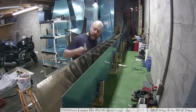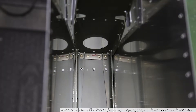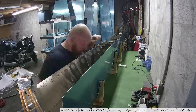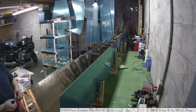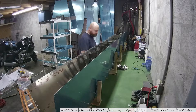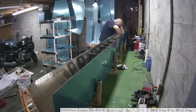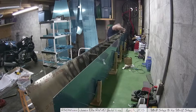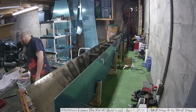It could not be done any other way. And again, this is another one of those examples of you really have to follow the instructions. You can see the three blind rivets next to the in-spar rib right next to it. You have to follow the instructions because if you try to go out of order, you can very easily screw up — and now there's no way to get that rivet in there. On either end, you have four rivets that you need to do with the squeezer, because those are not blind rivets — you have access there. But there you go. So this was a really long video — many hours in a single day, a Saturday. I finally moved those skins down because they were getting in the way. And I've got many more coming. The next video was another five hours. Good times.